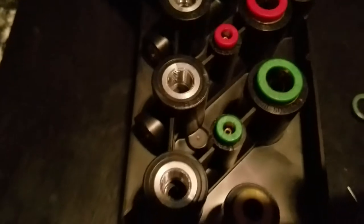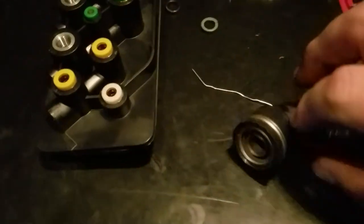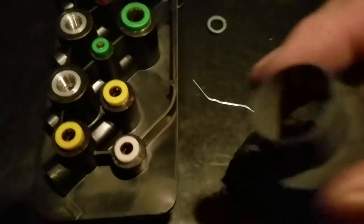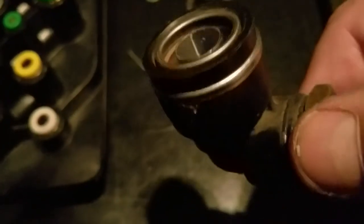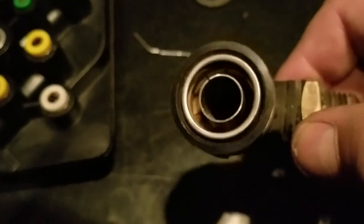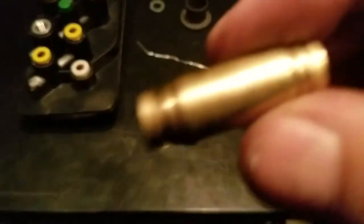Hopefully this will save you some money. You'll notice that one was brass — the brass ones have o-rings; plastic ones do not. I have a big plastic one that I had to change off my air tank right here, and I already have the part taken out so you can see it. This part was plastic instead of brass. The plastic one doesn't work like that — it is compressed in here by a ring but there is no o-ring in there.